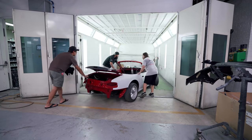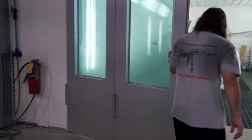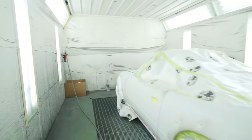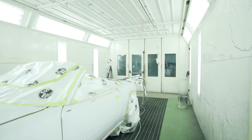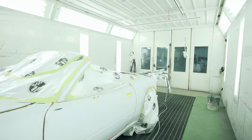We got the hood, the doors, and the fenders put back on the car and now we're ready to spray. Okay, here we are — we're getting ready to spray the Miata, get some color on this thing. We're touching up some of the bumpers out there, taping everything up, putting some primer on spots that we sanded a little too much. Then sealer, and then we're going to start spraying the base color and then the candy. Because this is a tri-coat, we're going to spray multiple layers of candy until we're happy with what the car looks like. It is currently about nine o'clock at night — we'll be going as late as we can.